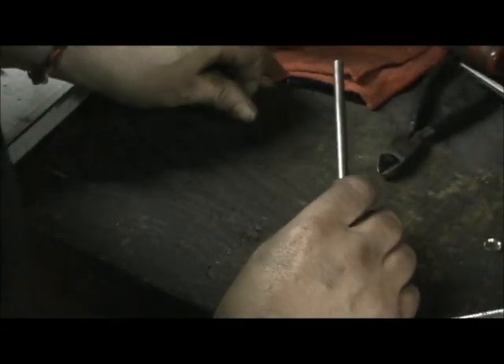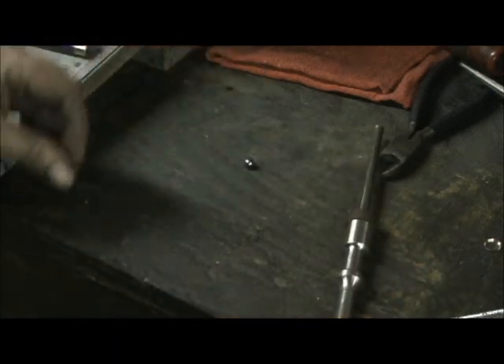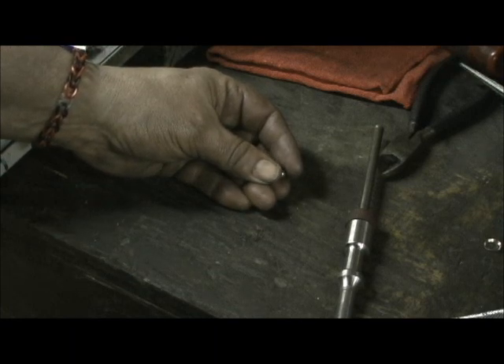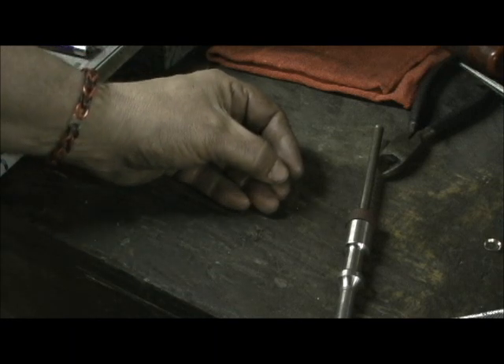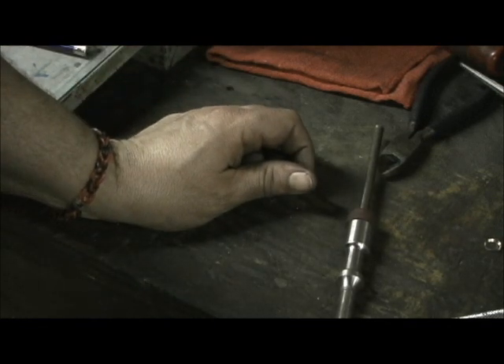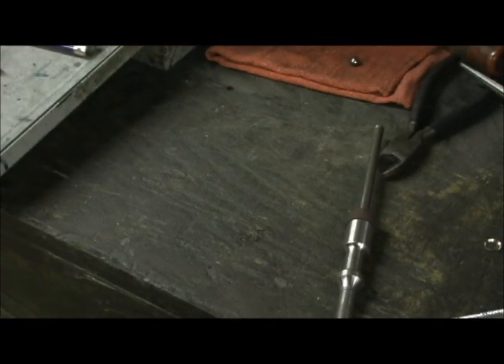Doing this time that's a little bit different. This is for the 5/16ths — I hardly ever get these things. This is called a tungsten ball. Its size is 3-1-3. They go up every thousandth. We never size the guide totally with this; I'll get it within a half-thousandth to a thousandth where the valve will barely push in. Let me show you so you can understand. I've already run it through all of them, but one that I've saved for you. So let's take a look at it.